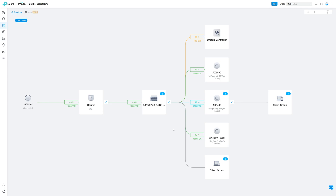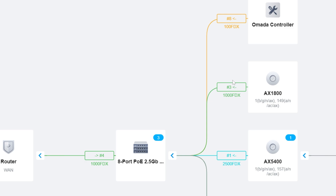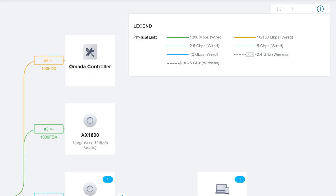I have the devices that I have, so it's not super complicated. One of the great things I really like about the Omada topology is the color coding. UniFi is just kind of all blue or dotted lines and sometimes it can be a mess. But with Omada, the topology is extremely easy to read. The color coding breaks things down by connection speed. At the top right-hand corner you can go to the legend and see what colors relate to what speed. Orange is a 10-100 connection — the TP-Link Omada controller doesn't require gigabit, so it shows as orange. Green is standard one gigabit per second. Different variations of blue or aqua give you 2.5, 5, or 10 gigabits per second, and dotted lines with a box show 2.4 or 5 GHz wireless connections.